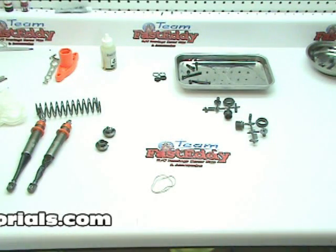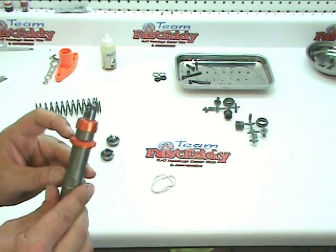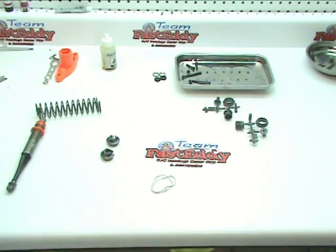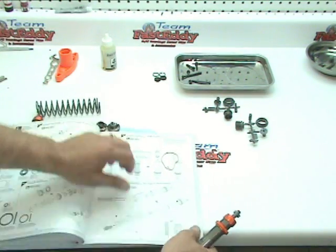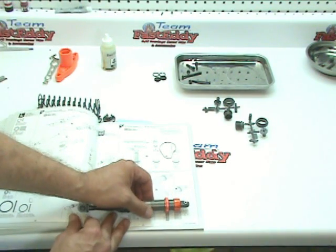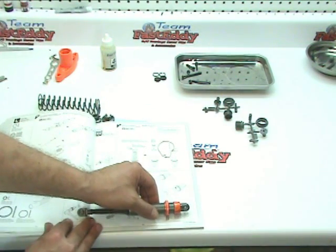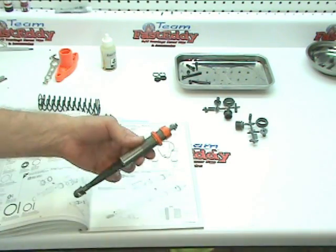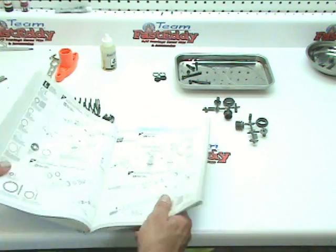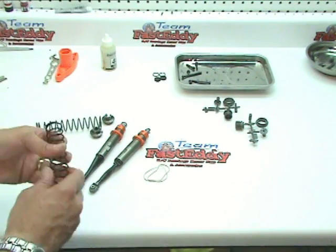For the last portion, we're going to go ahead and install our springs and the spring retainers. Go ahead and grab your manual — we want to adjust the spring retainers to approximately 10 millimeters. There's a one-to-one drawing in the manual that's going to show you exactly how far it should be, so make sure that they're adjusted properly. This is something you'll do later and it's not that critical, but you do want to come close. That'll adjust the ride height on your Baja.